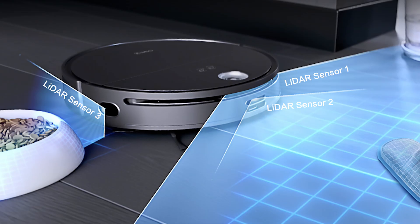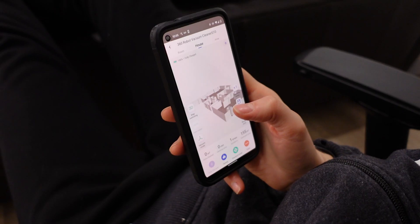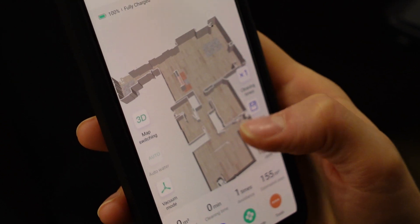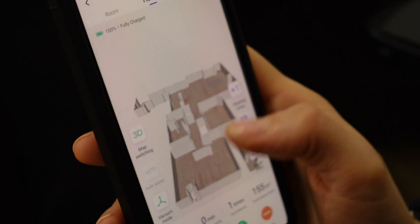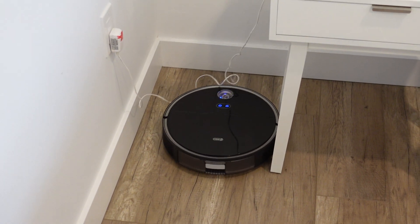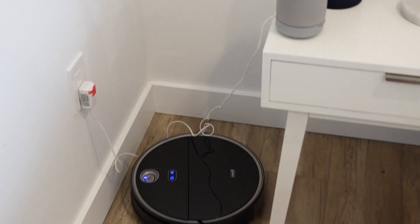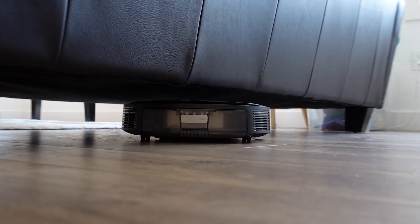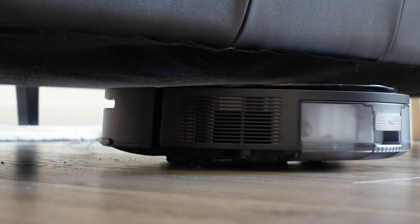So how exactly does a triple LiDAR system work? There are three lasers. The first is the main sensor used for far-range sensing of the entire house — it's able to detect rooms and make a 3D model map of your entire house. The second, or front laser, is used for detection of shorter-range objects nearby and close to the ground, allowing obstacle detection to be more real-time and dynamic when running and encountering unknown hazards. The third and final laser is able to detect the vertical distance of a nearby object, so it doesn't slam into something it cannot fit underneath.